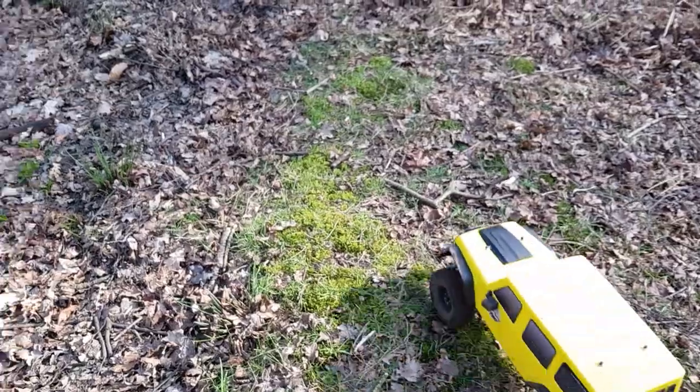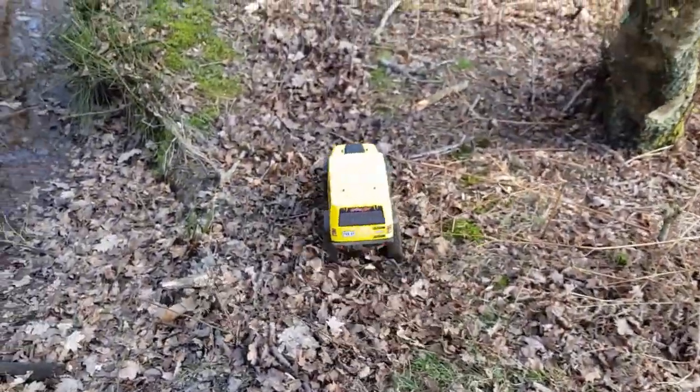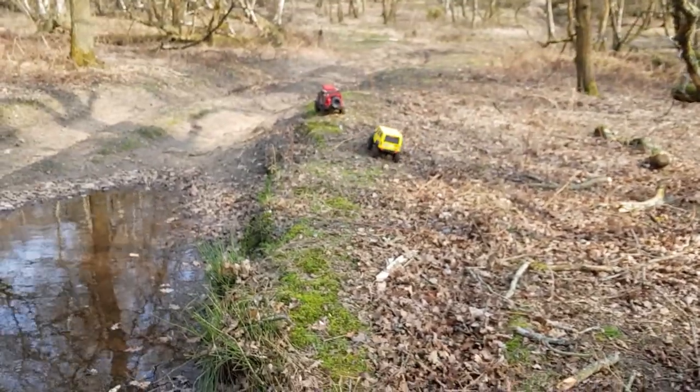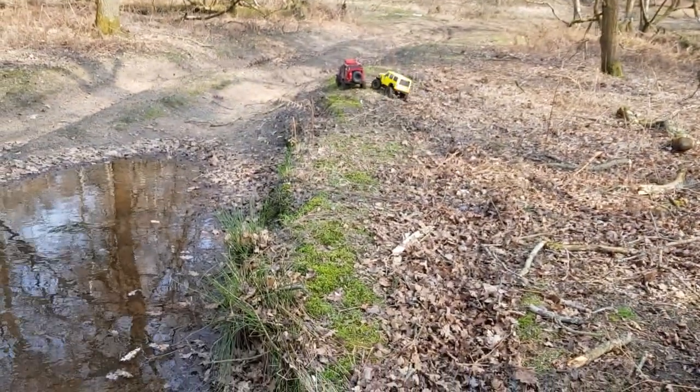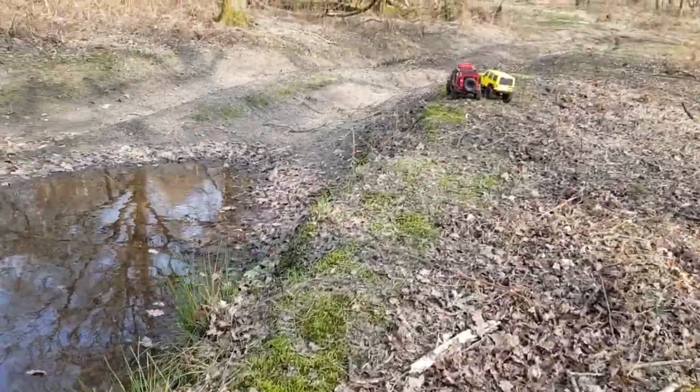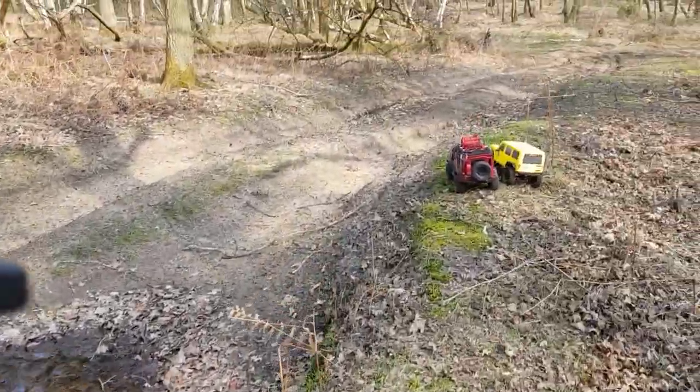The only thing I'd change on that, really, at the minute, from what I've seen, is I'd fiddle with the setup. Try and get a bit more. But then, even if you did dial more steering in, you're probably going to roll it a load more. Perhaps dial some more steering in, but more importantly, I think I'd want it a lot softer.